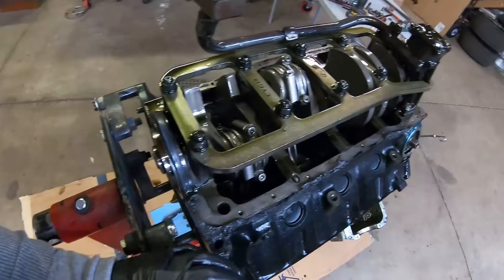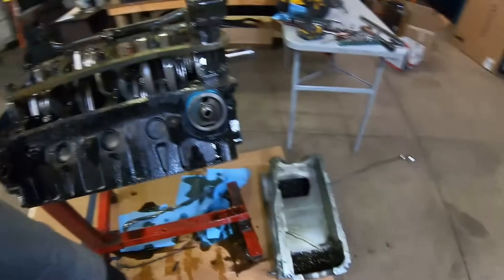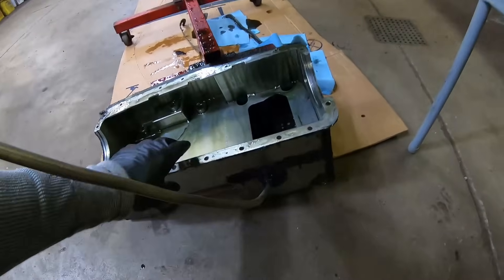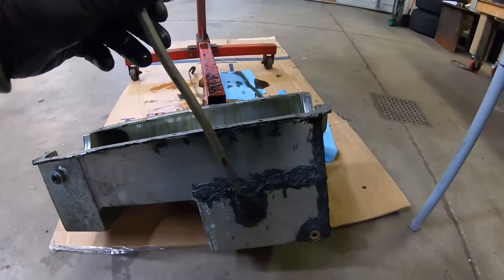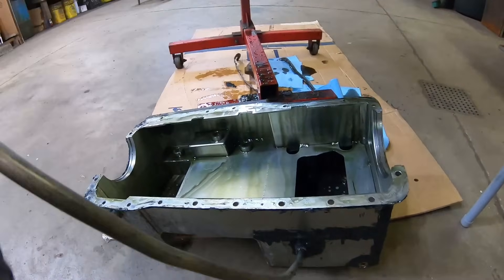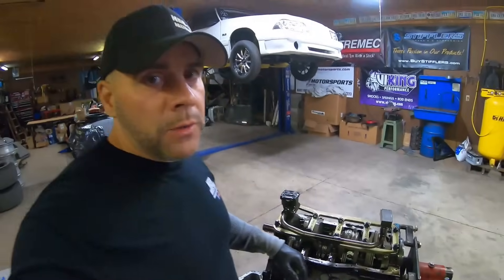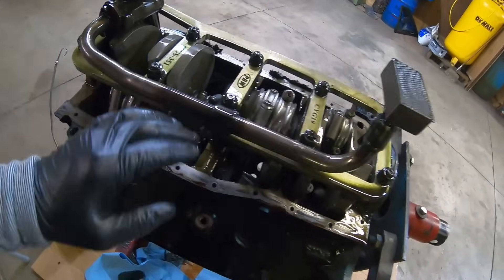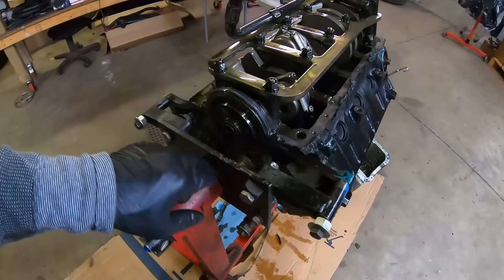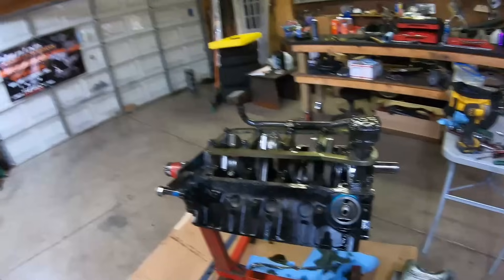The oil pan is kind of a pain to put on and off, but it's definitely a good oil pan. It started leaking on me after a couple of years - that's why you see all this RTV on here. Welds would start leaking here and there. I don't know if I'm going to be able to re-weld this and reuse it. Got a nice girdle on it. It's definitely clean. I'm always pushing for my motors to be zero balance - better on harmonics in the engine, it keeps the engines together. These are big block mains like I had spoken about before. This motor's definitely been through some horsepower. We're going to get the rest of the way apart tomorrow, check out all the details with the mains and the block itself, and get it over to the machine shop.